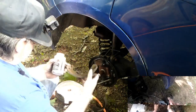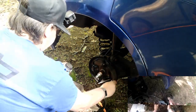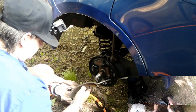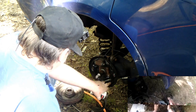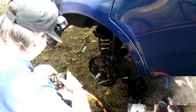So, these sit here, and when you step on the brakes, they move out. So they rub on these pads. Let's sit on here. And you can see the paint has been scraped off. So these are the points you want to put a little lube on.